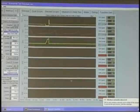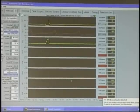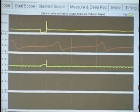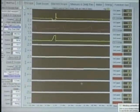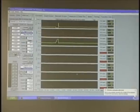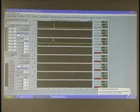Okay, you can see here I've got three things up here. I've got the fuel injection voltage, I've got my AC signal, and what's this thing right here? That's my current ramping of the actual injector. Write this note down. I get a lot of guys that make this mistake. If I am checking amperage on a fuel injector or a coil, I need to be on the same cylinder. Some guys will take the voltage off number three cylinder and put the amp clamp on number one. You're not going to see that on your scope, are you? Why? Different firing order, different time. So you need to put them on the same one. Does that make sense? Okay.